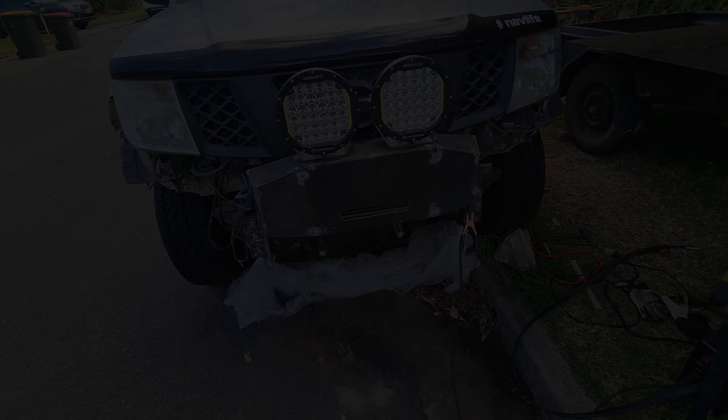It's been raining for a few days but I've just come back. I've put the little bracing pieces on - just off-cuts, tacked at the moment - and now it doesn't flex anymore when I push it. My mate said just tack it at the bottom, it's fine, because I'm going to have the bottom plates there anyway and I can properly weld the whole sides when I do the final weld-up. I want to get the top pieces on now because that'll close it in and make it look way better - I'll try to at least cut two pieces and tack them on today.